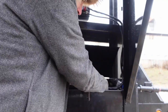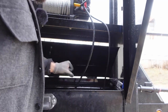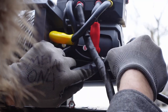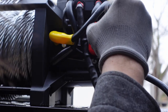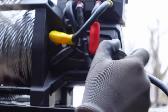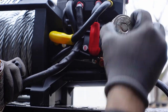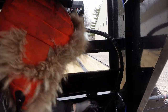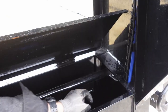I'm happier having the connection locked up. The wires are going to go through this hole and we'll put one of the Anderson connectors on there and tie it into the battery. I have battery corrosion preventative because this is an exposed electrical connection and I really don't want it to corrode. I'll make sure it's protected — it's exposed and they didn't give you a little boot.